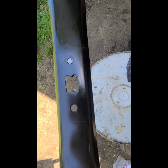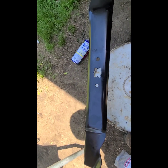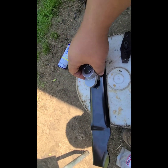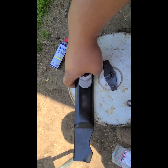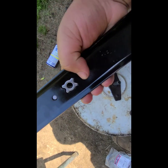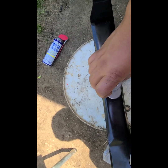This blade has that oval-shaped star point like you see a lot nowadays. I had a little bit of a hard time finding this blade in 20 inch but I found it for like 20 dollars. I ordered this brand new adapter that fits right in this hole. This is our standard five-eighths push mower blade mount bolt. It's important how you orient this — we orient this plate washer with the tabs up so it can grab inside the two holes on the side. We're just going to slip this down in, and there's another part I'm going to show you once I get this on here.